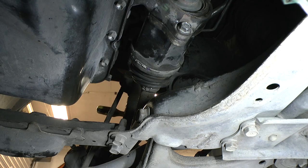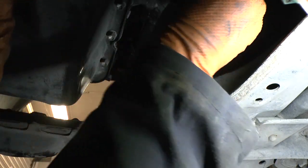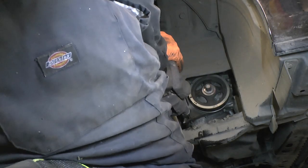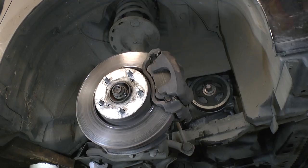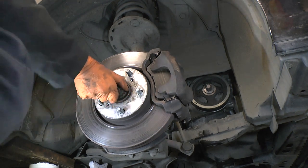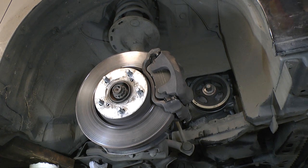I don't know the correct torque setting on these so 30Nm seems good enough for this size of bolt — please correct me in the comments if you know better, I'll get it right next time. I've put that nut on just a little bit to hold it. What I want to do first is make sure that the new alternator is working and the belt is staying on properly, because if it isn't all this has been a waste of time.